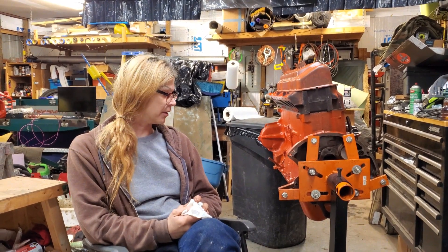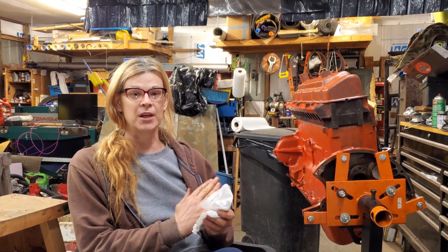It's a slant six starting to go together. I'm really not happy with the cam and lifters — there's some wear. One of the lifters was damaged, had a chip out of it, so I did not put it back in. I robbed a used lifter out of another motor, so it's better than it was. The cam and these lifters are not really that good, but the slant six doesn't have super strong valve springs so we're not doing anything wild with it — hopefully it holds up for a while. I'm not going to invest a ton of money into this build; when we build a 318 or 360 we'll put the money into cam and lifters for that.